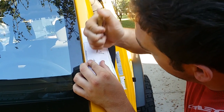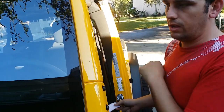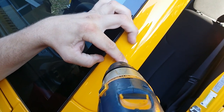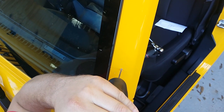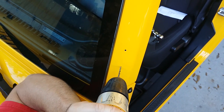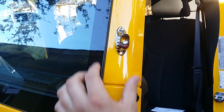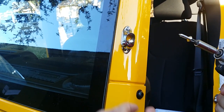That one came out good, and one more. There are our two center punches — we're going to drill eighth-inch holes through those. Now we're going to put eighth-inch holes through the center punches we just pulled. Clearly the guide didn't line the holes up perfectly, but it will still work, so I'm going to go ahead and put this in.